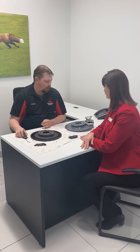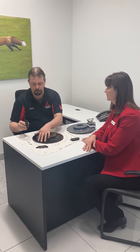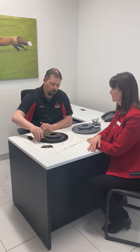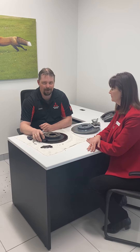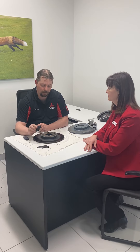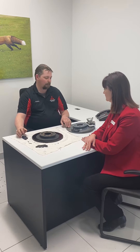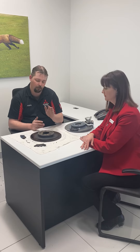When you change your brakes, I always recommend you change your pads and your rotors at the same time. What happens is brake pads wear to the rotor, and if you put new pads on an old rotor you're going to get two things: inadequate brake performance, and most noticeably, noise — squealing, chirping, all those noises we hate to hear coming from our car. If you change your brake pads and rotors at the same time and they're put on properly, you'll have no noise issues and better brake performance for the life of the pad.